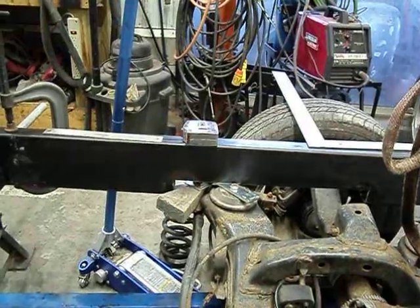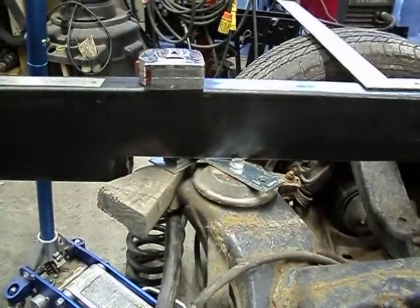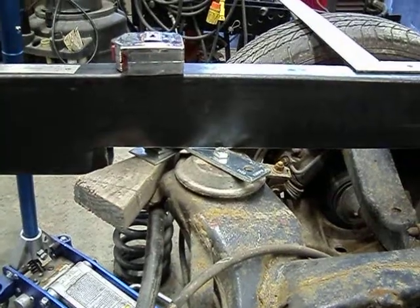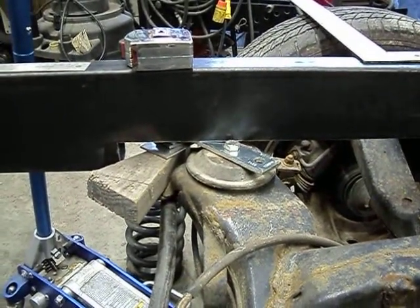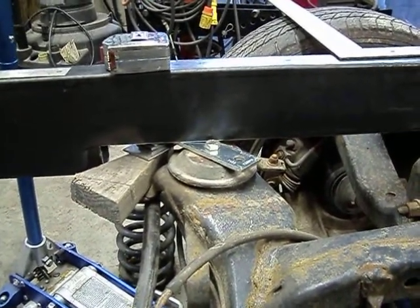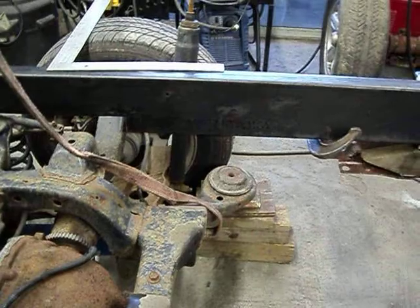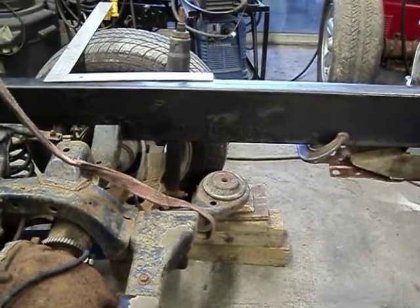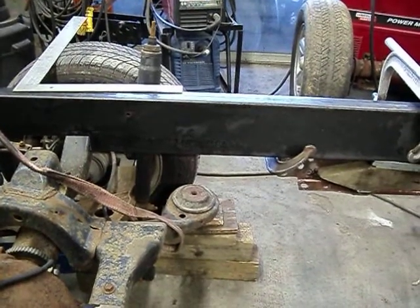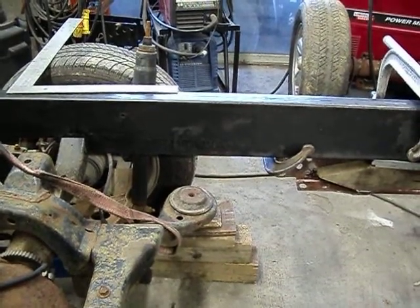As you can see, it's notched out and you can see spacers and what have you. The spacers are just temporary stuff in there to hold it up to the right height. I'm going to have to cut some more pieces — some ¼ inch plate — and that will be the pads that mount the rear pads on the suspension. In front, I'm going to have to build a couple of towers, and that's one of them there. It'll be about 7 inches, probably using half a piece of 4 inch heavy wall pipe, then weld it up into the frame.